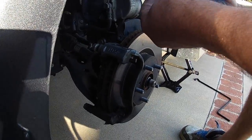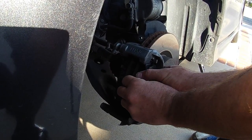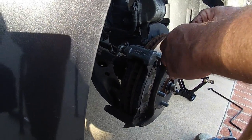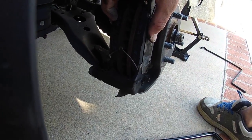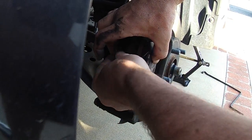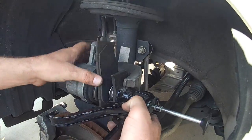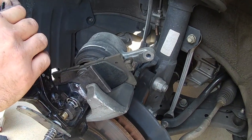This is the front brakes we're working on right now. We're going to be doing the rear brakes in a minute. Make sure you get these suckers in there. What do you call those? Pad springs? Tension springs. They just pull the pads away from the rotor, and I think they also keep tension up against the backside of the caliper. I'm going to depress the piston first so that I can fit it back over the new brake pads.